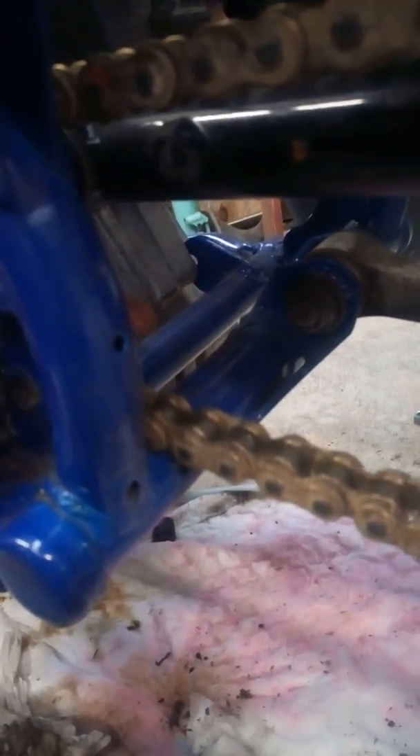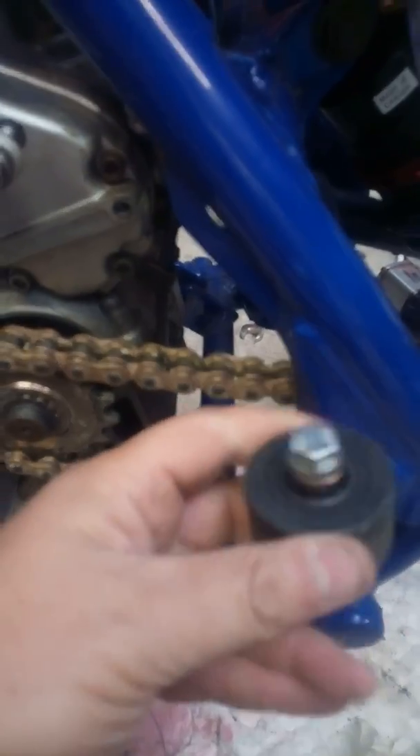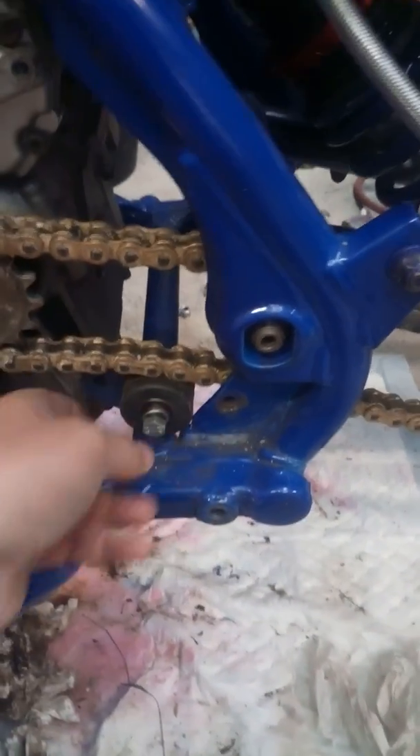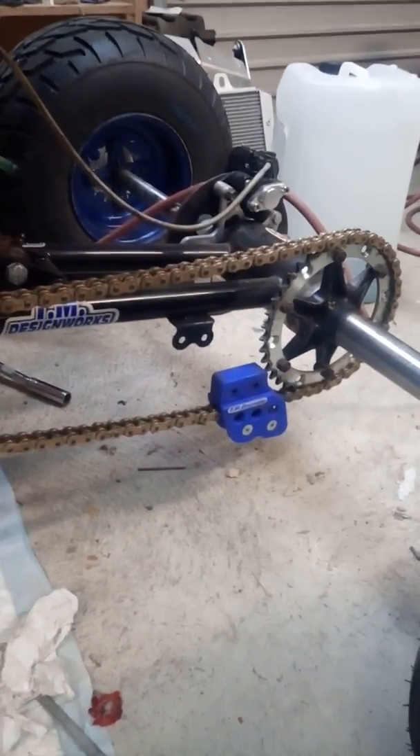Also, because of the position of his drive sprocket, it was engaging the bottom of the chassis — you can see it still lying on there. He had this little gizmo, like a wee rubber wheel with a bearing in it, bolted through here to push the chain up, so it was constantly running on this. It probably would have lasted about 10 miles to be honest.